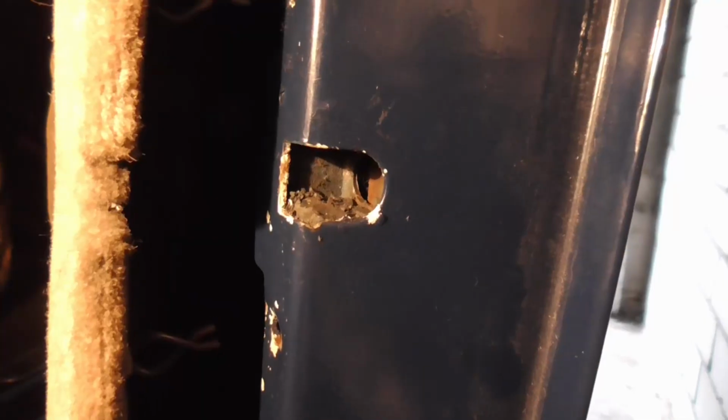In my constant rush behind all the rattling noises, I have once again had the opportunity to look at a properly restored Model A and found out that the doors have been equipped with rubbers in points where my car doesn't have any rubbers. Instead, there are just pieces of metal which are loosely clattering about, which is of course one more rattling noise to take care of, and it keeps the door from being properly and tightly seated against the frame and permits it to rattle about. So I bought a new set of rubbers and went on installing those.